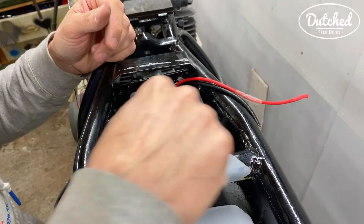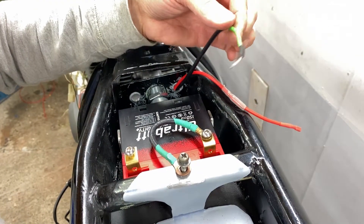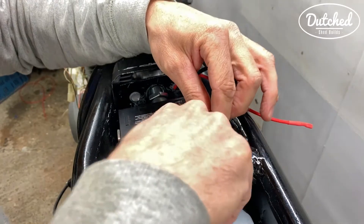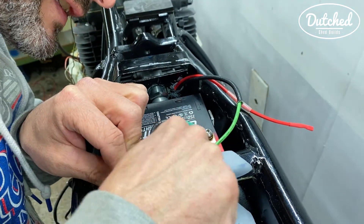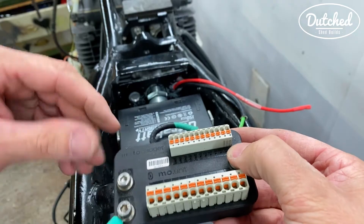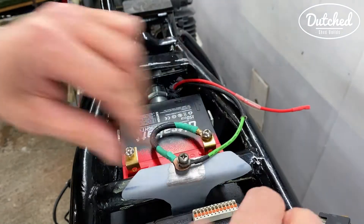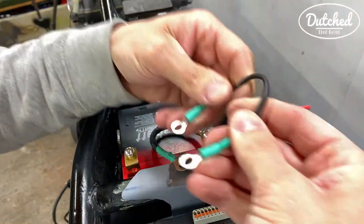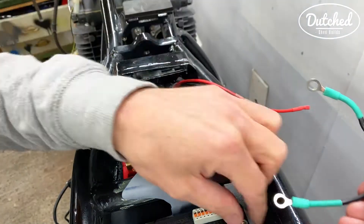The battery is in with the grounding. The plate is grounded through the frame. I've got these wires coming out of the regulator rectifier — this one is going to go to the starter solenoid and this one is ground. I'm going to use this point so I don't have to cut any of the OEM wires. This is the M unit blue. It's got two grounding points so they go right in here. I can use these points as grounds as well. We need to ground this because even though it's grounded on the plate, it's a good thing to also ground it to the battery so you've got a good solid ground.